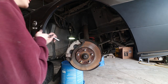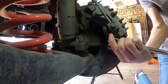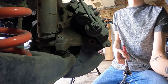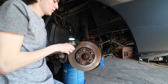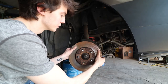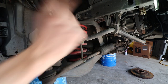There are two bolts on the back side of the caliper here. We're going to see if we can break these with just a ratchet. Just going to hang this right on this bucket where the GoPro is sitting. The rotor will just pop right out — we can just take it right off.